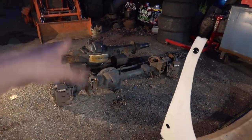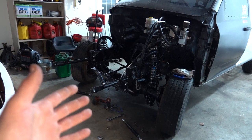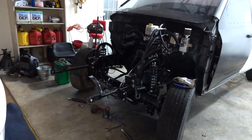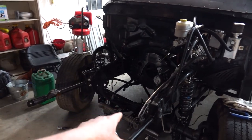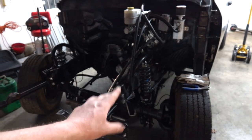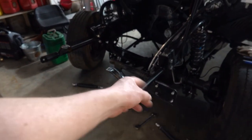So anyway, that's kind of the rundown of what's going on, why we're going to have two rears for the truck. I feel it's easier to swap an entire rear than to do a gear change at UCC with a limited slip, because we can just pull this out, undo the bars, undo the track bar, undo the four link bars, undo the shocks, unhook the brakes, undo the rack and pinion, and just slide this thing out, slide that in, and bolt everything back up.